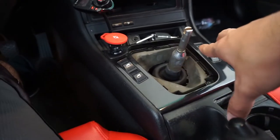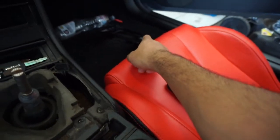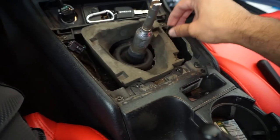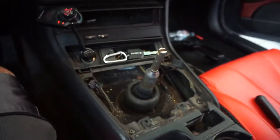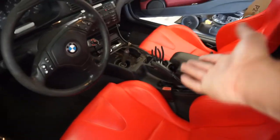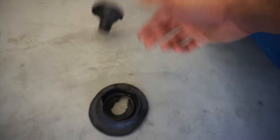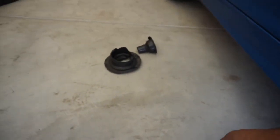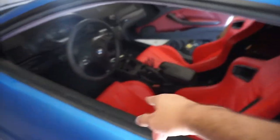Literally, you've got to take this rubber out — this is it from the top — then jack up the car and get on the bottom. I had two clips for the window button things on top, clip those out, then you take this rubber out and it just comes out, there's nothing holding on to it. My car came with a lighter from BMW. That didn't really take that long, just a few pushes and some sweat. So I took it out — I ripped it out because the short shifter I'm installing has four bolts and is chassis-mounted, so I don't really need it. Now jack up the car, get under the car, and start with the clip.